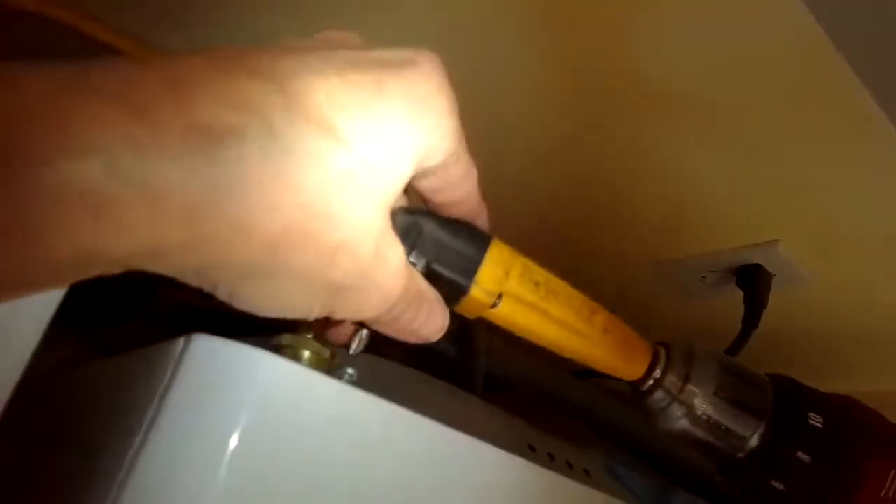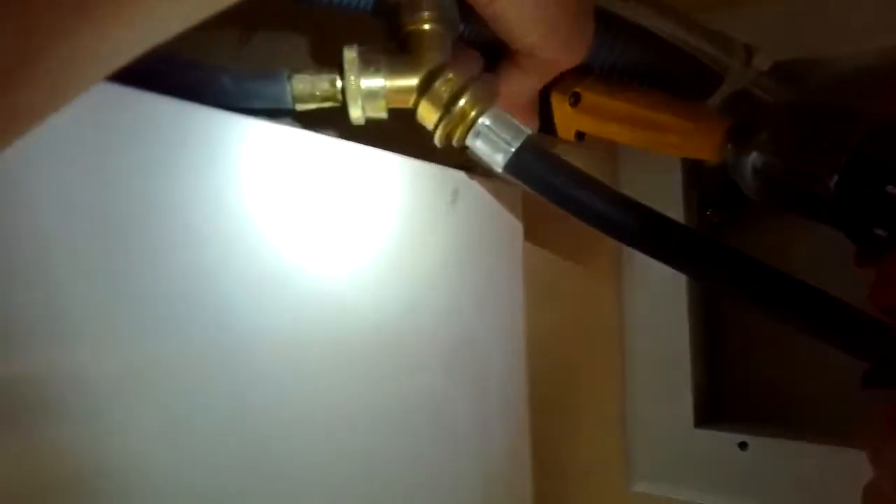Get the front panel back into position on the top panel and push it toward you so it locks in. Make sure there's no gap at all, then add the two Phillips head screws on the back that hold the top panel on — use an angle tool to get into these tight spaces, or move the dryer away from the wall for more room. And that's it — plug it in, give it a test, and you can hear the difference.